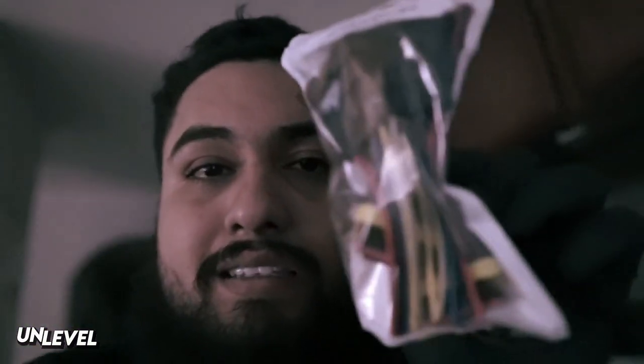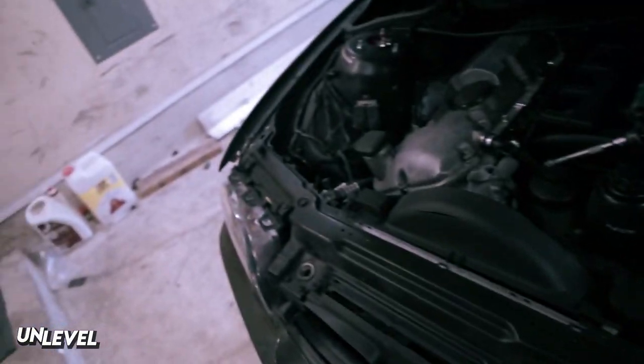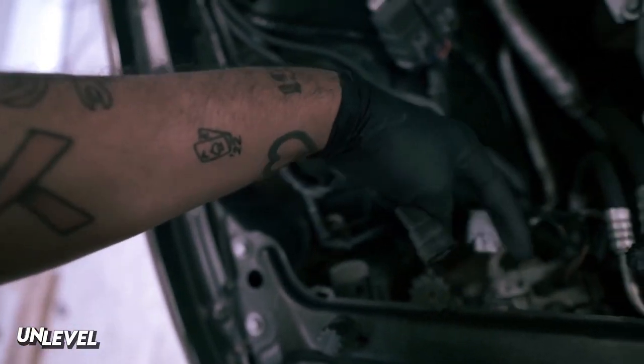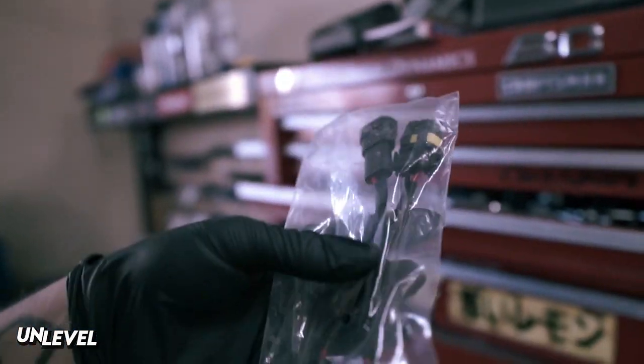Not quite done — I still have the wiring to do. The splitters I ordered did not get here today; they sent me something else instead, so I have to wait for the correct splitters. I could make my own but I don't know if I have all the plugs I need. Basically I'm going to wire off this plug here to connect this into this so I can run two low beams at the same time.